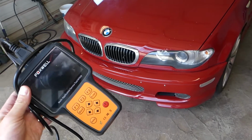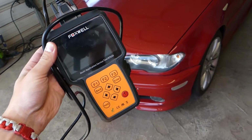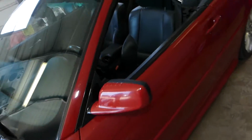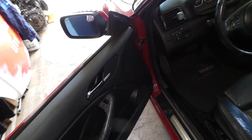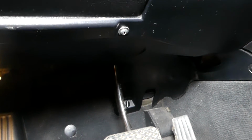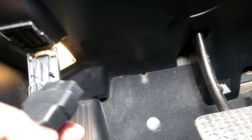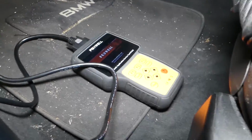So this is guys the tool that we're using. We'll demonstrate on this BMW, but we will show you how many makes and models it supports guys. So you can find it listed in the description of the video below. So all we have to do guys, okay, you have to find your OBD port. You will need to go underneath the vehicle, usually it will be under the steering wheel somewhere, or somewhere here you have an OBD port in our case. Okay, it's this thing right here. Perfect, and the scanner is on, so we can proceed now.